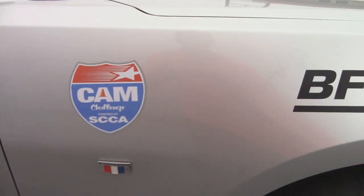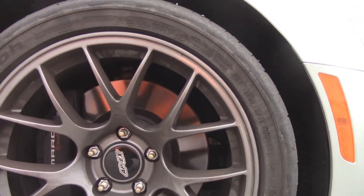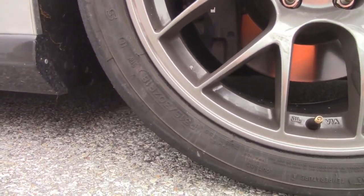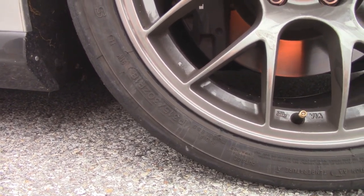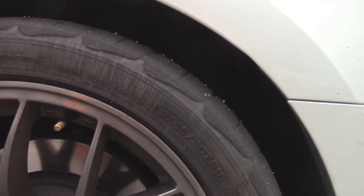Big boys. I have to put extended studs in. Apparently the only people that sell extended studs for this size are people in Australia, from the Holdens and stuff like that. But it turns out that the regular half inch ones from ARP, you can actually find the ones that sneak in there. So I found the right ones, and they work.